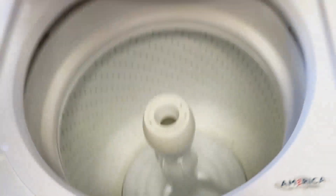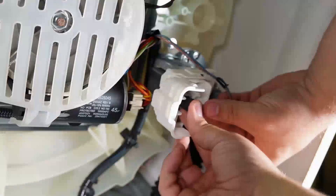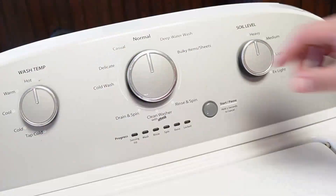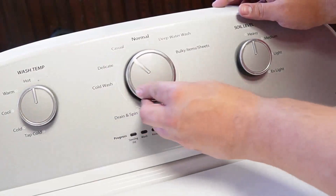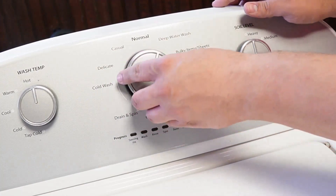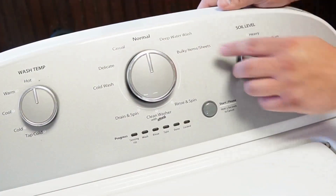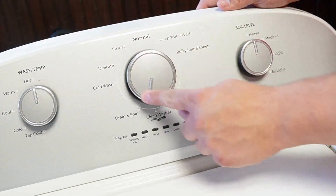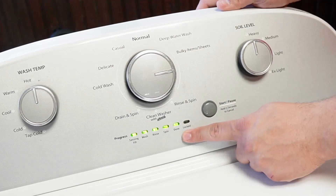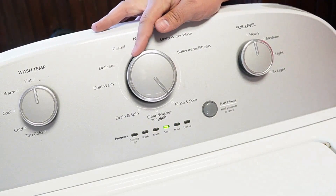Now that we've done the first reset, let's attempt to recalibrate this washing machine through the calibration mode. This is a must-do if you've installed any new parts on the washing machine, from a board to a balancing rod. With the washing machine freshly rebooted, rotate the dial again counterclockwise 360 degrees. Then you'll turn the knob right three clicks, left once, then right once again — all within three seconds. If done correctly, all the lights at the bottom of the washing machine control should flash on and off, showing that you've entered diagnostic mode.